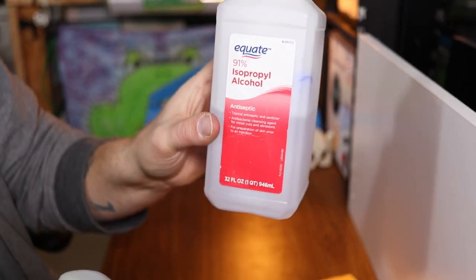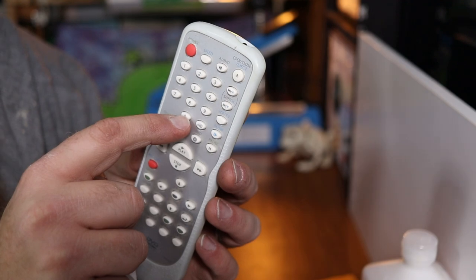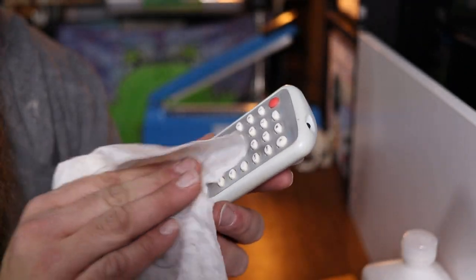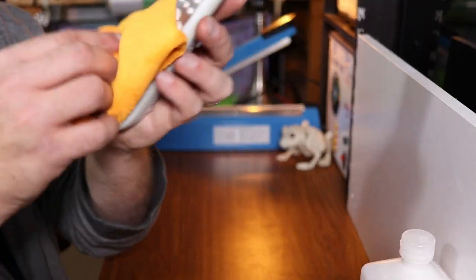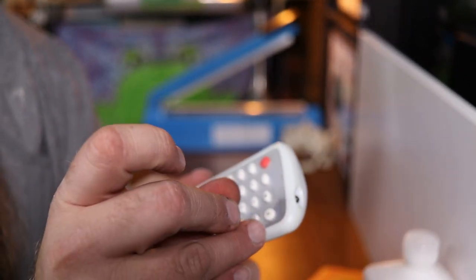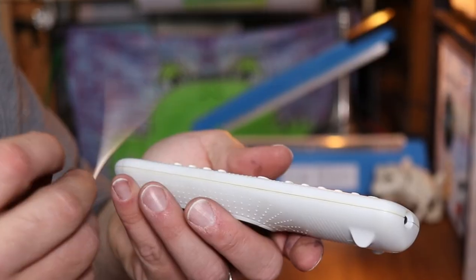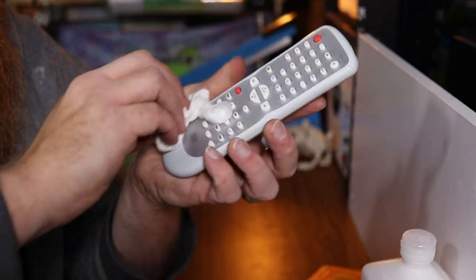A couple of the common things I use are rubbing alcohol, goof off, and wet wipes. I start off with the wet wipes because something like rubbing alcohol can actually wear off the numbers from the keys, which adds too much cosmetic damage. With wet wipes you can get the top pretty clean without damaging any of the print — just get as much gunk off as you possibly can and wipe off any excess with a towel. For gunk caked in the little crevices, I grab a toothpick and dig out as much as possible, including around the sides where the top and bottom connect, then take your wet wipe again to clean it all off.